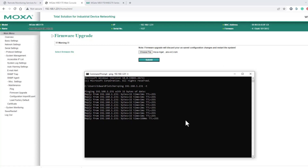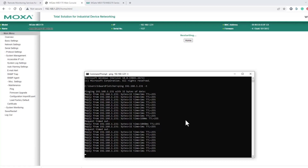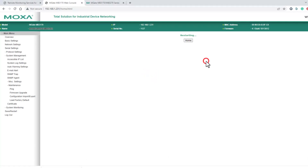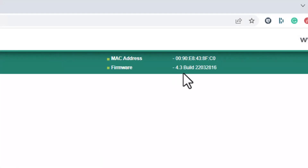We should see one or two reply timeouts during the update. Sometimes it might time out once, get a couple of replies, then time out again — so you'll either see two timeouts in a row, or a timeout, a couple of chirps, and then another timeout. Here we can see it's pinging back and looks nice and stable. Coming back to the web interface and clicking Home, we can see on the upper right-hand side that version 4.3 has been uploaded.